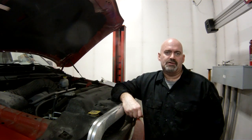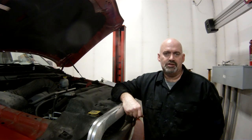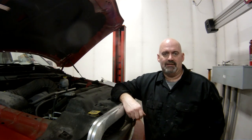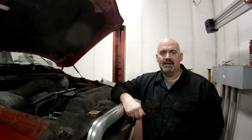If you're the owner of a 2003 through 2011 Dodge, Chrysler, or Jeep product with the 5.7 Hemi motor, and you're experiencing engine misfire codes like P301, P305, etc., and a rough running condition, you may have a cracked valve spring and I'm going to show you a couple tips on where to look.